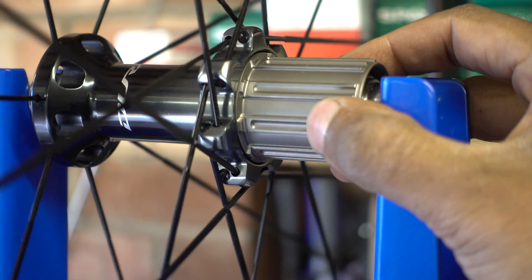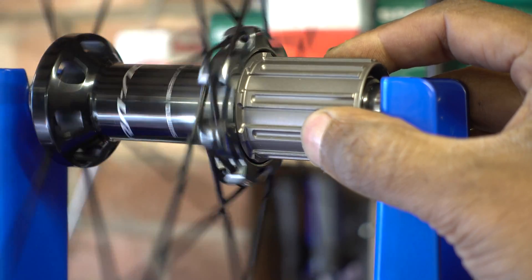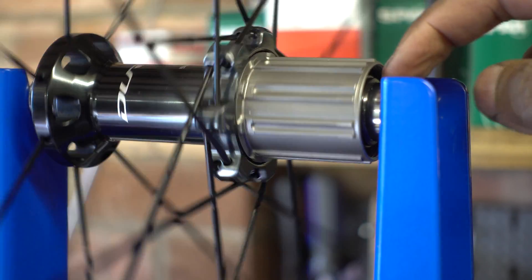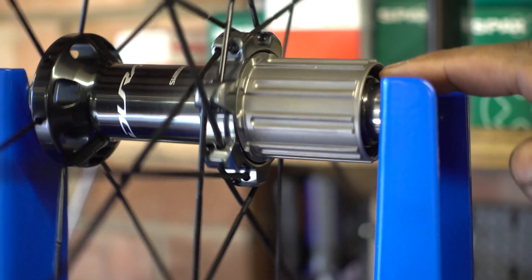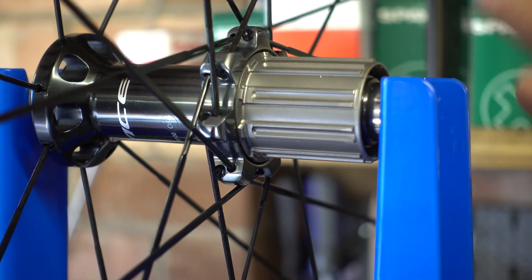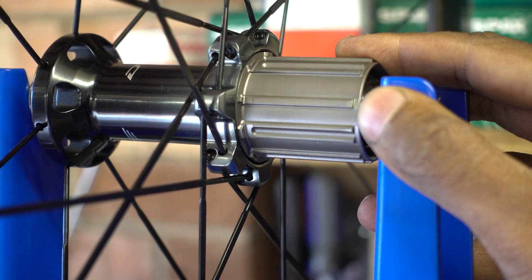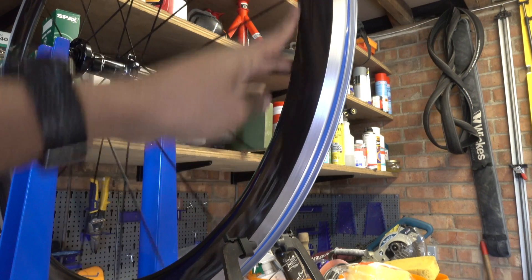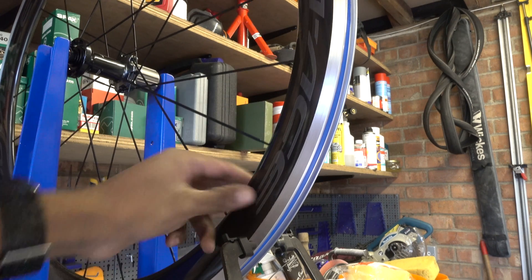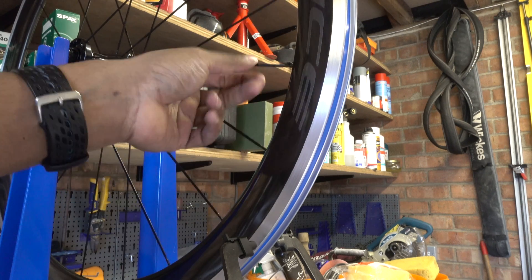This is the rear hub and it is very similar to my old C35 9000s. One noticeable difference is it is considerably noisier — probably not apparent on the YouTube video but I can definitely hear it. The bearings are very free again. This cup and cone system is a proven design given Shimano use it in all their wheels. The forging and machining quality are excellent, and the runout on this wheel was 0.12 millimetres — very true for something straight from a factory. On the spin test I could hear something: there's actually some debris inside the rim. Nothing to worry about, but when you spend 1,350 pounds on a set of wheels, you don't expect it.